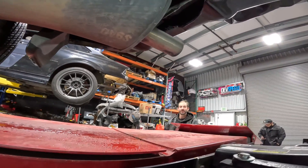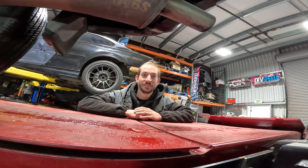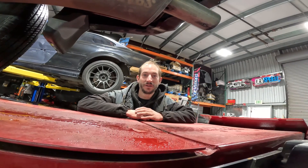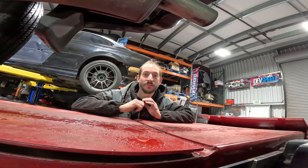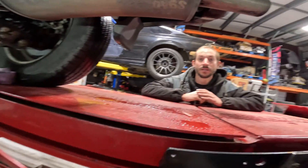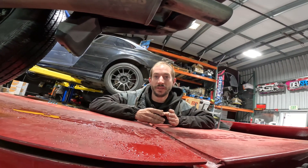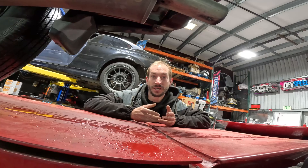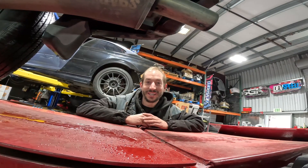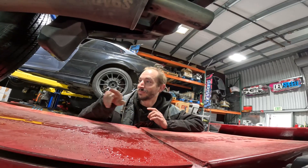Walker was mentioning that he was driving this thing in the snow and felt the front wheel slipping, and it just sent power straight to the back. It sends power right to the back when it starts feeling the front wheel slip. Primarily it's front-wheel drive, and when you need it, it becomes all-wheel drive. That gives way better fuel mileage during normal driving, and when you actually need the system, it's there. Yesterday, he pulled a 2007 Toyota Tacoma out of a ditch and it only spun a little bit of tire — the CR-V could handle that.